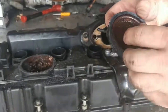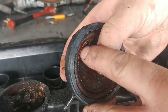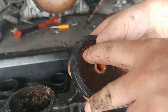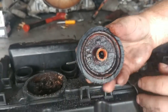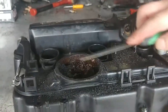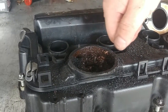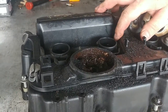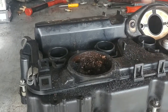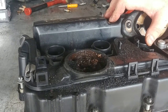That cut in the diaphragm is what causes the lean mixture problems, the misfires, the whistling noises, and all those symptoms that cost a lot of money. So what we're going to do is take our file — any edge that's not perfectly smooth, we're just going to file it, take a rag and wipe it clean, or use a shop vacuum. Get it nice and clean with no oil, no debris, and then it's pretty easy to install the spring, new valve, and the retaining clip. We'll pause the video, clean this, and then show you what it looks like when it's all clean.